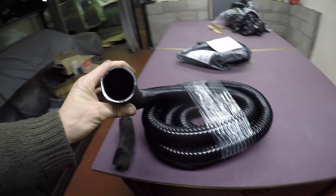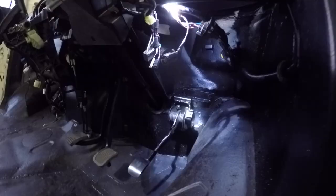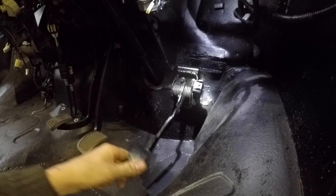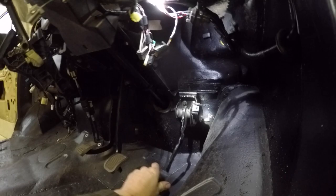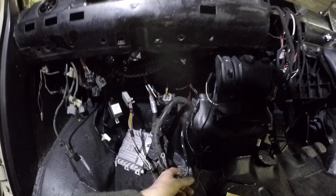Got my air ducting - quite tough stuff actually, 50mm - better than that old crappy stuff that was all falling apart. I just welded a bit of angle on the top because I wanted to brace it, because it was just flexing a bit when I put pressure on it - just the bulkhead was flexing - so that's a bit tougher now, happy with that. Just putting the air pipes in on the heating - they're a bit hard getting in - got them two in for the windscreen, and then the other two on the other side going under the fuse box. I've still got to mount them properly, but they're in. So I've just got to get the big ones in now - I'm going to use the same bore as the others and just pack it out a bit and put them on the inside.